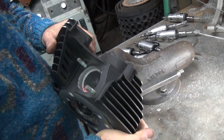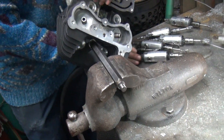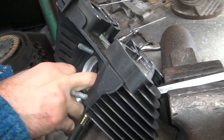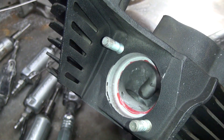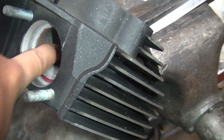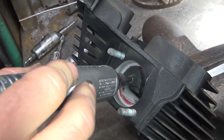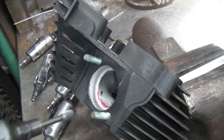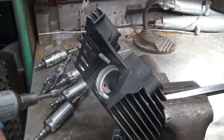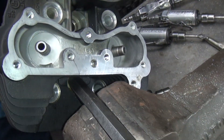So now you flip it around this way and see what we really cut on this side. So where's the area that's bad? Right here's the bad spot. We need more metal through here. So if you're going to plug the port up on this side — if you plug that port up right through there, it'll flow more air. We'll just have to leave it.